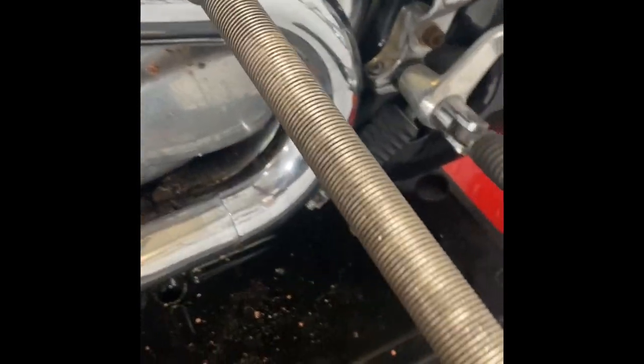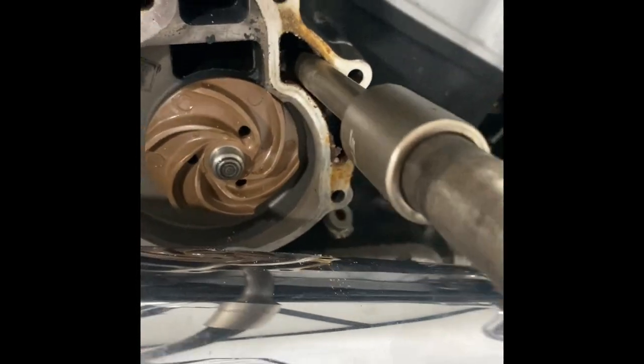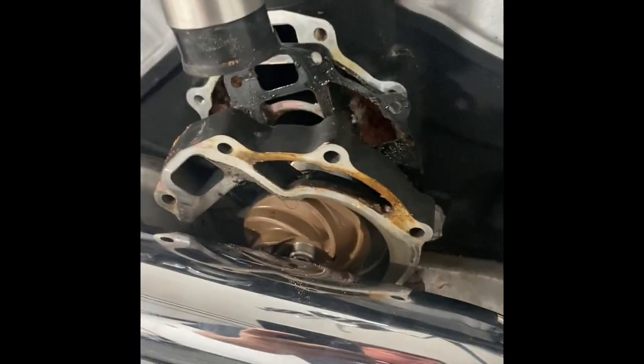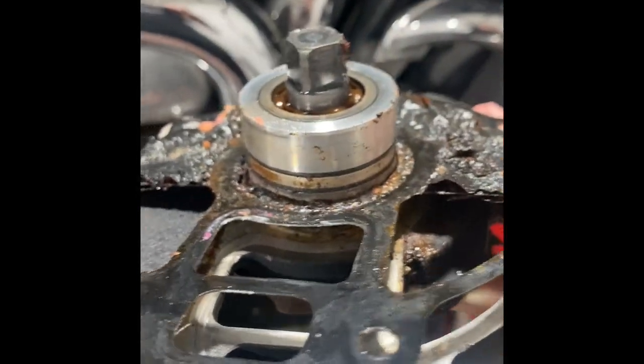You're just going to put it right in there, just like so. You know what I mean? You're going to clip it on there, all the way back in there, just like that. All right, I've got to put the phone down, but then you're just going to slide it out so I can get it off there. So literally one smack of the slide hammer and it popped right out, okay? A lot easier and a lot better than sitting there smacking it and prying it with a pry bar.